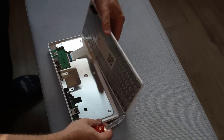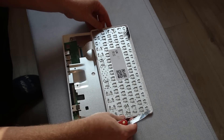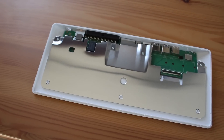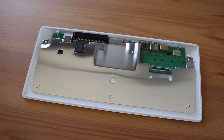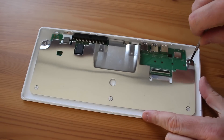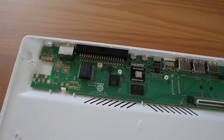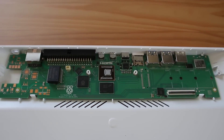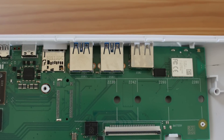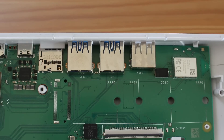Initially, I wanted to overclock my Pi 500, so I went straight to 3 GHz — up from 2.4 GHz on my first attempt — and it was completely stable. That's largely due to the big heatsink inside it. Depending on your use case, this results in a speed increase of between 15 and 20 percent. Taking apart my Pi 500, there are silkscreen markings and tracks laid down for an M.2 slot that would allow you to connect an SSD drive.